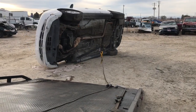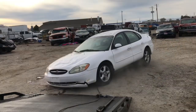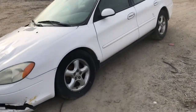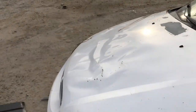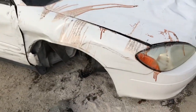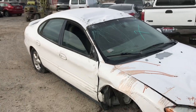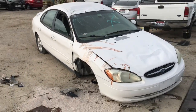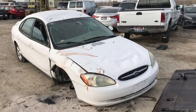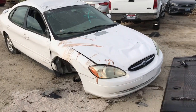This one's missing a wheel, so you see it came over all the way. Usually when there's a wheel there, it's going to stop on its side and then you continue on over. This one, being that the wheel's completely gone, it just went ahead and came all the way over. Usually it comes on its side — then you take your roll pull off, your sister hook, and then you just chain to that front A-arm and bring it on over.